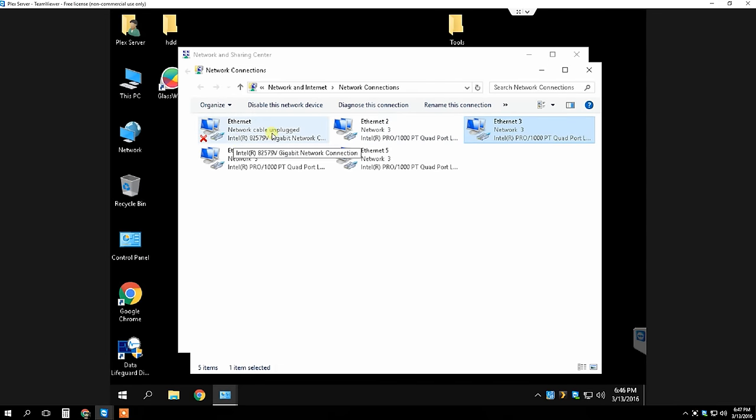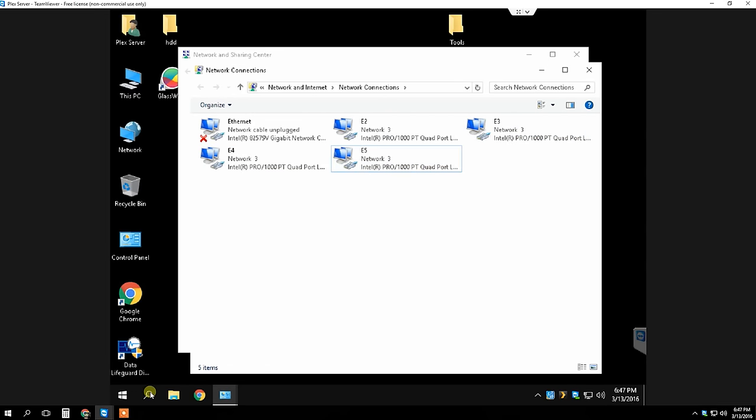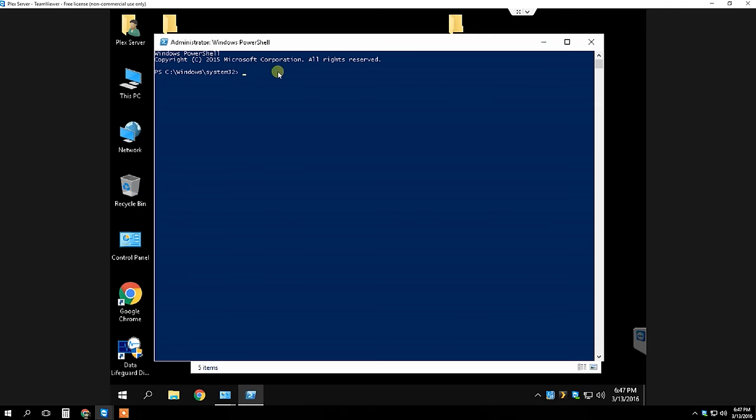Anyways, if you don't know what you're doing, it takes a little bit to get everything figured out. And that is basically what I've spent most of this evening doing, trying to figure out this whole network teaming thing. So what I did is I went into my server and I set up the network teaming with the 4 connected ports. Then I logged into my HP switch, and that's my computer because it's crazy loud. I set up trunking for those 4 ports, and then I got it to connect and everything was good. And then it registers as a 4 gigabit connection in Windows.